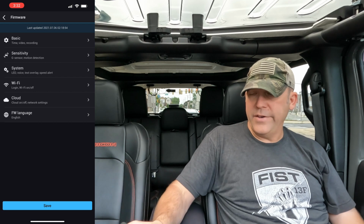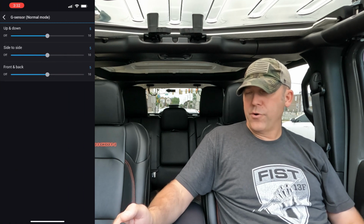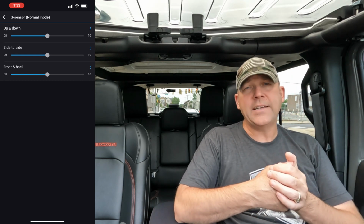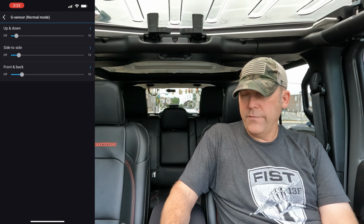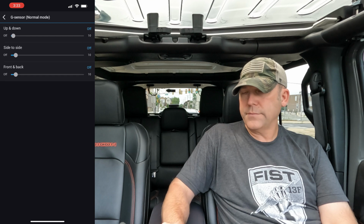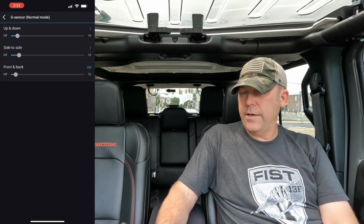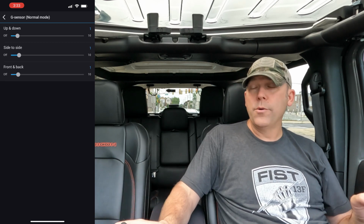Okay, let's go down to sensitivity. Next one we're going to check is G sensor for normal driving. I turn normal driving all the way down, because if you hit a bump, it's going to register an event. You don't want that while you're just driving down the road. Trust me, when you get in an accident, it's going to record it. I turn this all the way down, front and back, sides, all that. I turn mine almost completely off for normal mode. We'll just put it on 1. I don't want anything like a regular pothole to register as an event.